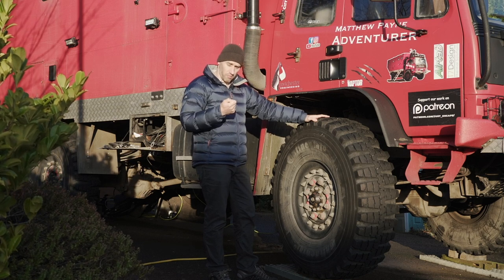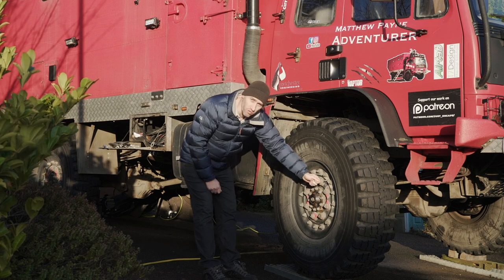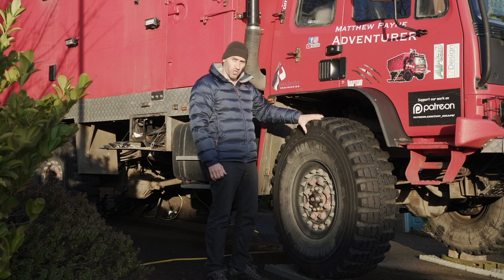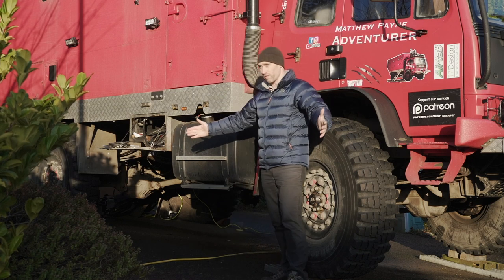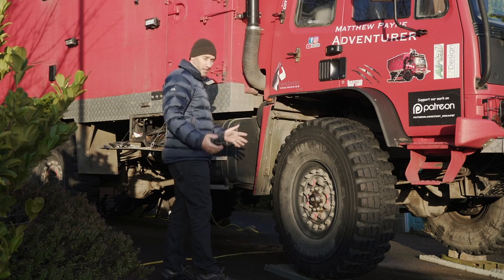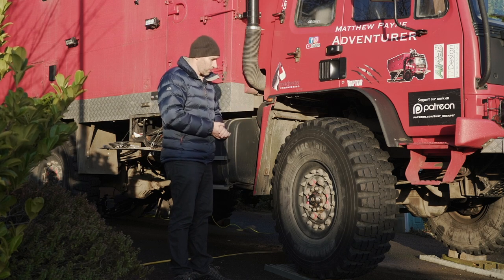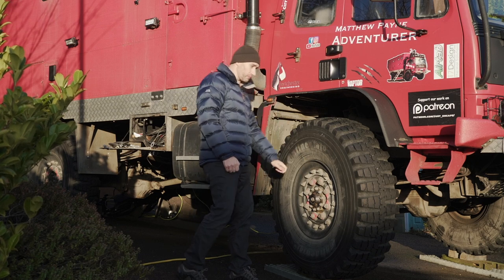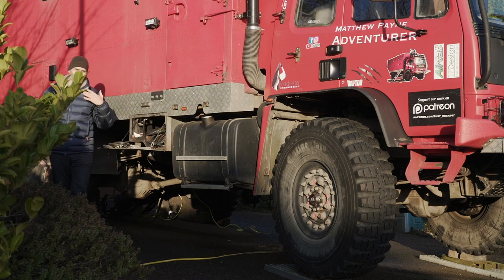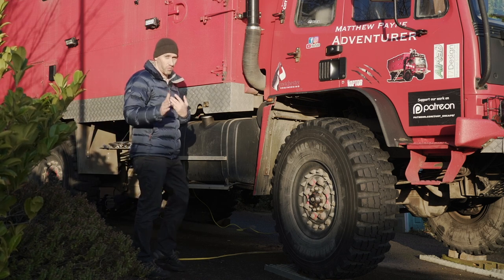With my truck came a small inflator on the end of an airline which requires you to hold it on — that's a really bad idea because you're standing in the danger zone. Take a 45-degree angle from the tire — that's the danger zone. If this tire was to explode and you're standing there, as you saw in the video clip, if you don't die you're going to be seriously messed up. So standing right there is a bad idea. You want to be away from the tire, out of the danger zone.